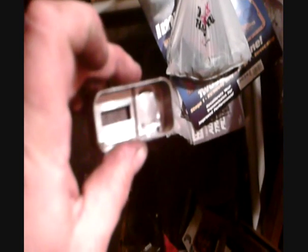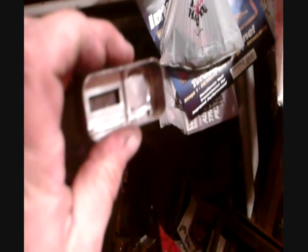And the Briggs version — the baffling is kind of hard to see. The baffle: I just enlarged the holes by bending them, and I drilled the hole on the bottom. You see the hole — when I put it together that hole is going to be on the bottom to allow the oil to drain back to the motor quicker. The screen always covers the hole in the baffling. So you've got the hole on the bottom, then you figure out which is the bottom of the plate — which is this part because it's got the humps. Just turn it around and this one pushes together. Then you've got the big hole, and that's how you do the mod.